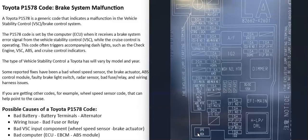The next thing that could cause this is some kind of wiring problem, or possibly a bad fuse or a bad relay. So it's a good idea to go check your fuses and relays and be sure those are good. The main fuses to check are anything labeled like ABS or like IG2 — like the fuse here — but it's a good idea to check for any bad fuses or relays.